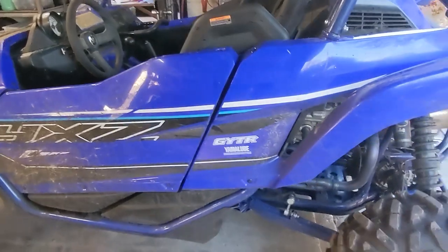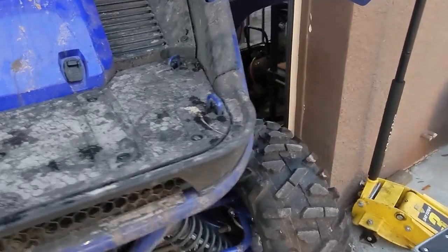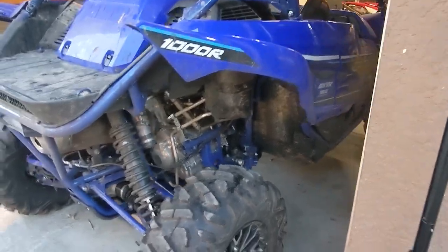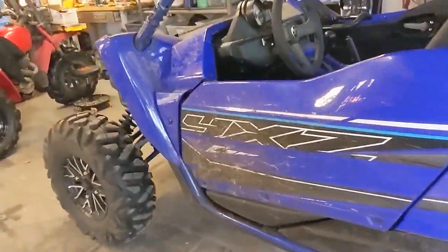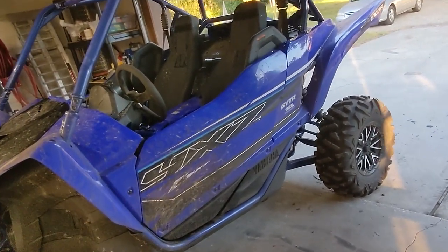I readjusted my throttle and it turns out my throttle was adjusted wrong from the factory — I was not getting full throttle due to the little rubber damper thing. I put a zip tie on that piece of rubber to keep it from compressing so much, and now I'm actually getting full throttle. I was able to look into the throttle body with everything taken apart and see that the way my throttle cable was adjusted from the factory, I was getting probably 80% throttle. It feels a little more potent now when you put your foot to the floor. I do like the feel of the throttle a little better with the zip tie mod — but that trick did not help fix the throttle hanging issue. That was just a nice little thing I did while I was in there.